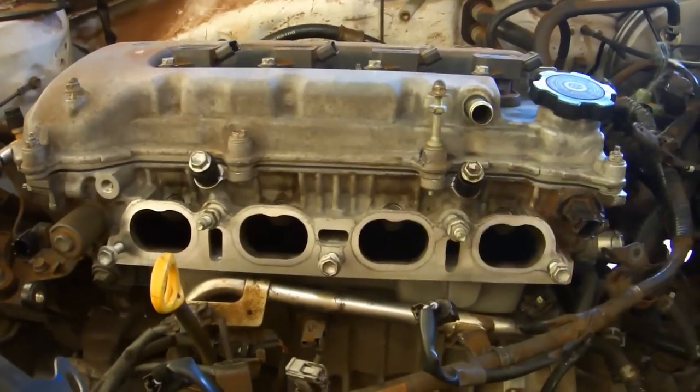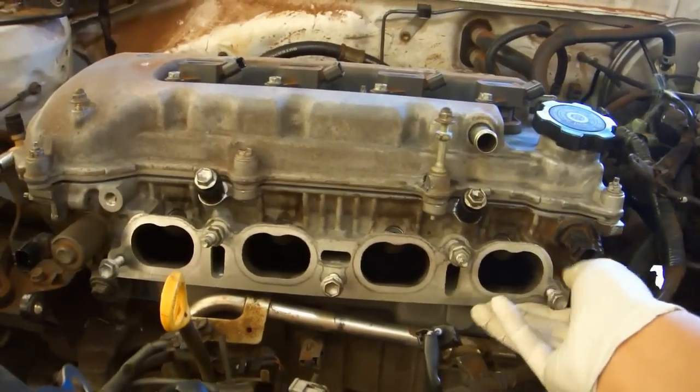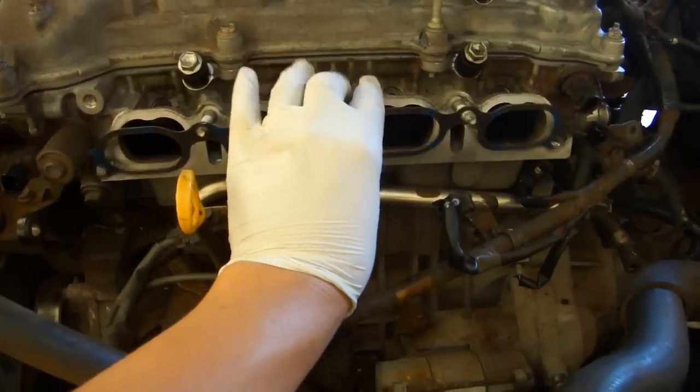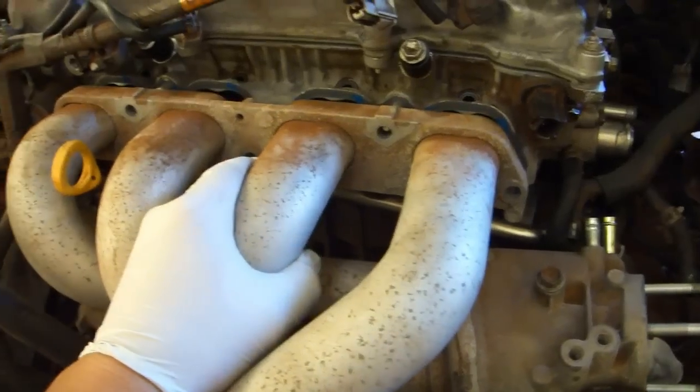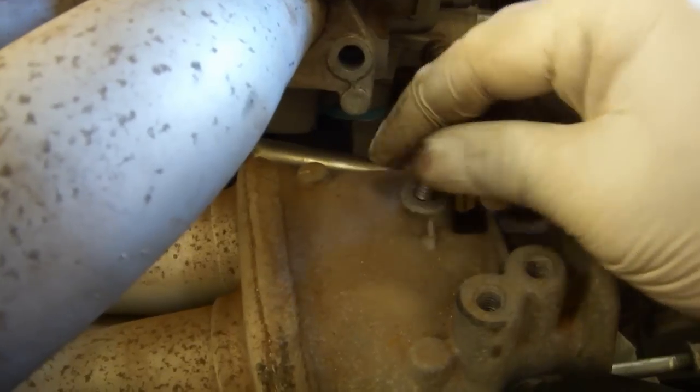Remove any stuffing you might have placed in the cylinder head. Take out the bolts and nuts. Place the new intake manifold gasket. Make sure the engine wire is out of the way. Place the intake manifold. Remove the hose clamp bolt.